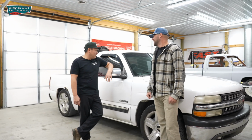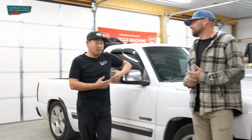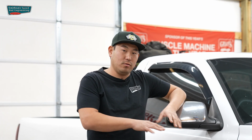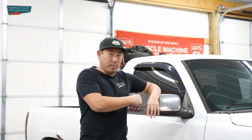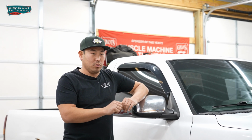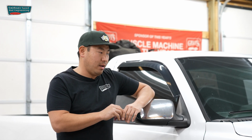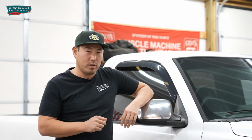Gotcha. Well, I'm glad that you brought it to us, and it's fun. This is a lot different than what you've normally seen us work on, right? We're normally working on a little bit older vehicles and more on the show car side versus the motorsport side. We do a ton of business with Wilwood, and they've been great to work with through this whole process, because there was a lot of learning we needed to do. This truck has 6 piston Wilwoods on the front. It's got 4 pistons on the back for the regular braking, and then we also put an additional set of 4 piston calipers on the rear just for the handbrake. And everything has worked out really nice. Joe at Wilwood's been great to work with, kind of helped set us up with what we need.